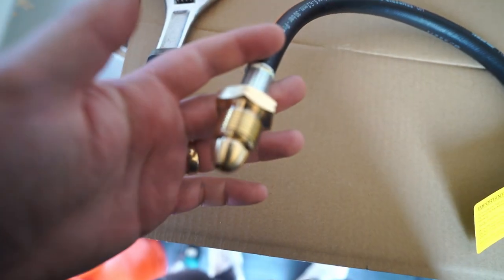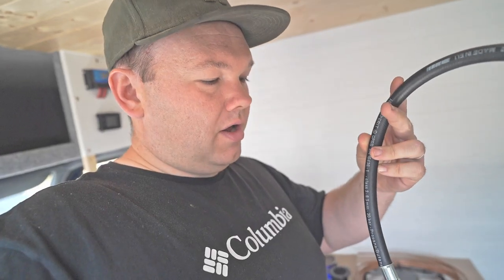To go from the gas bottle to the regulator you need a high-pressure hose — this rubber hose is the only one allowed in the camper van, and it stays within the gas locker between the gas bottle and the regulator. Lastly, the gas bottle has to be secured within the gas locker in at least two different ways. There are grills that slot into the base of the bottle with the right diameter, and then you have one or two straps around it. I always go with straps because they are adjustable if you need to swap to a different size bottle.